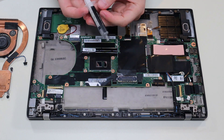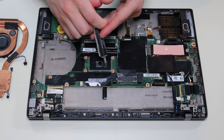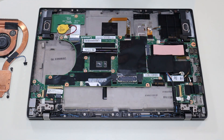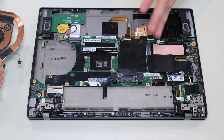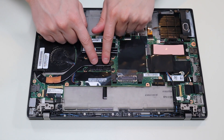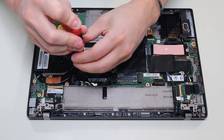Now that I'm ready to reapply my thermal paste, I'm going to put just a little bit down. You don't want to put too much — I'll put a little bit here and a little bit over here. That's as much thermal paste as you need. If you put too much it could actually have a reverse effect — it could lock the heat in rather than facilitate its transport out of your computer. Below in the description I'll have some thermal paste options, from cheap to expensive — you get what you pay for. Go ahead and put this in there and give it a nice press, and that's how you would reapply thermal paste to your heat sink.